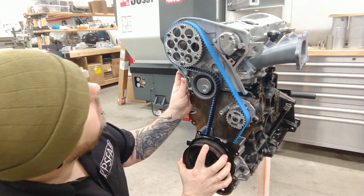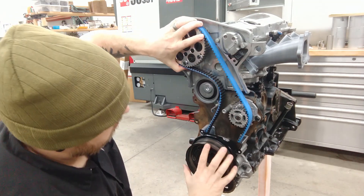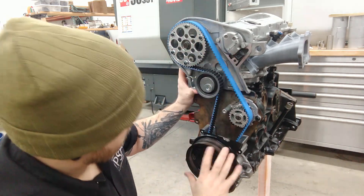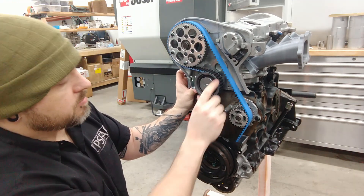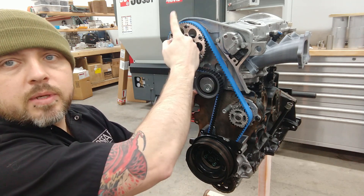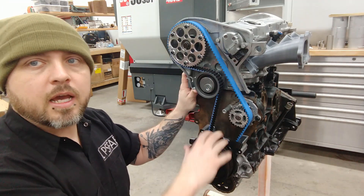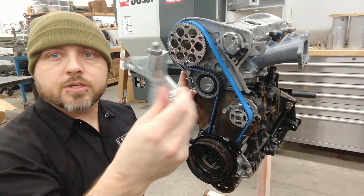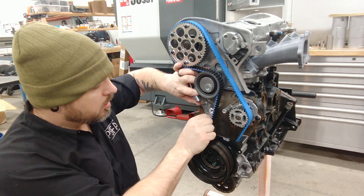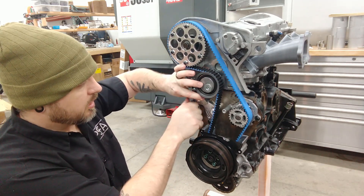Rotate the crank back about twice as far as this mark needs to move to line up with the timing mark on the valve cover. So it's pretty easy to do. As I start to tighten this up, we're still a tooth off - we need to go one more tooth. I'm back maybe about an inch between these marks now, but I can see that when I put some tension on this tensioner I've got about three quarters of an inch here and a little over three eighths here. I think if I put the tensioner on and rotate this to TDC the cam is going to line up perfectly. Let's go ahead and install this tensioner - pretty straightforward, just hold it up a little bit to get the bolt started, start with the bottom one, get that one started, then push up underneath and get that next one started.